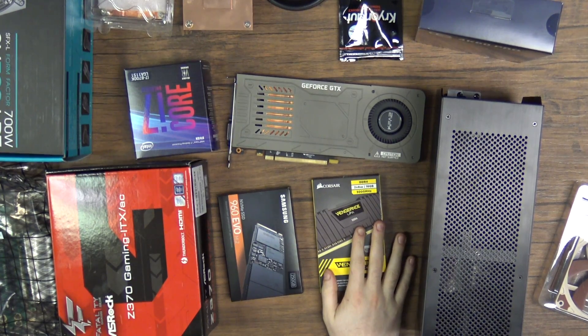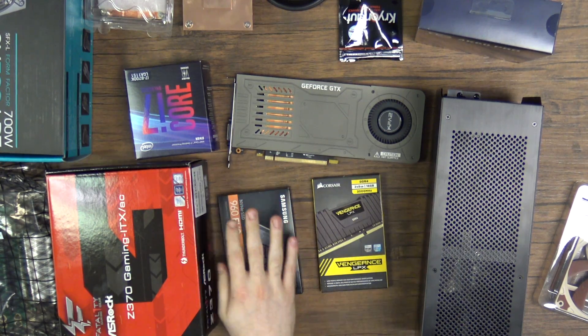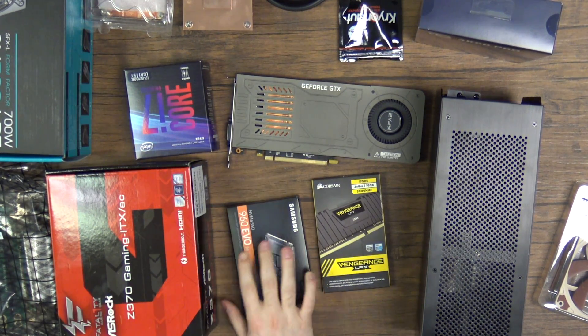When it comes to the parts in this system, we're going for 16 gigs of RAM. That should be enough because it's just for streaming — streaming only takes two to three gigs of RAM, then Windows takes two gigs, so 16 gigs is actually overkill. We could go to 32 if we wanted to; you'd need two 16-gig sticks, but that's up to you. We've got a 250 gigabyte M.2 drive because I love having Windows on M.2. There's also a one terabyte SSD already in here because I needed to transport it from the UK. It also makes restarts really, really quick.